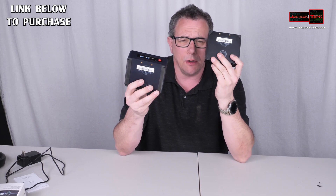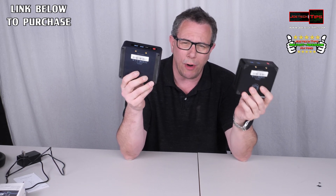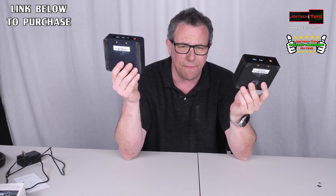They're powerful little mini computers — quad-core Celeron J4105 and quad-core Celeron N5105, both 10 watts. 2.5 GHz base, 2.9 GHz boost — great product. Maximum RAM on this one is 8 gigs, and it comes with an M.2 SSD. These are not NVMe drives on either of them, but they both have upgrade paths to a 2.5-inch solid state drive.